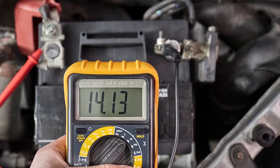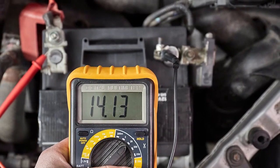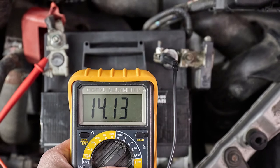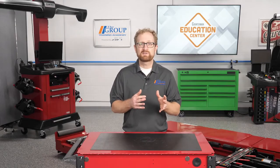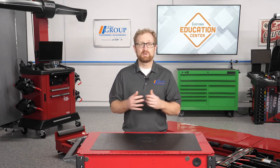So can broken or frayed wires inside a connector or the alternator wiring harness. That's why your professional customers need to test those connections by performing voltage drop checks whenever they're installing a replacement alternator. For parts specialists, a bench tester can verify that starters and alternators are functioning properly when they go on the shelf and off the shelf.